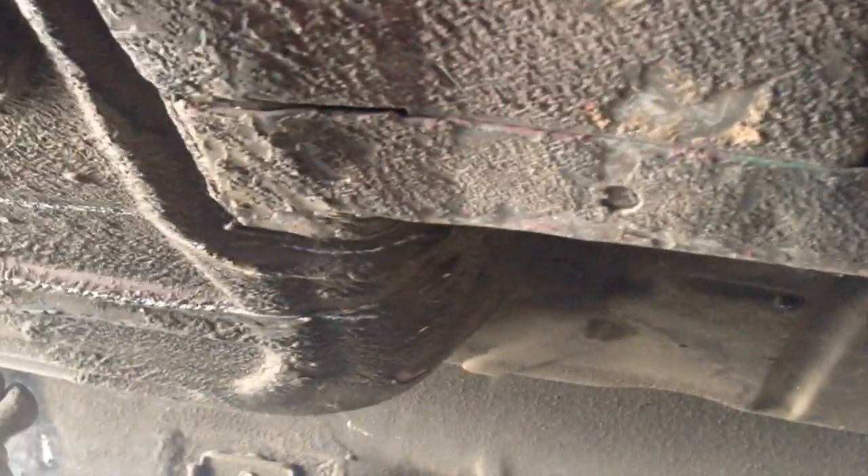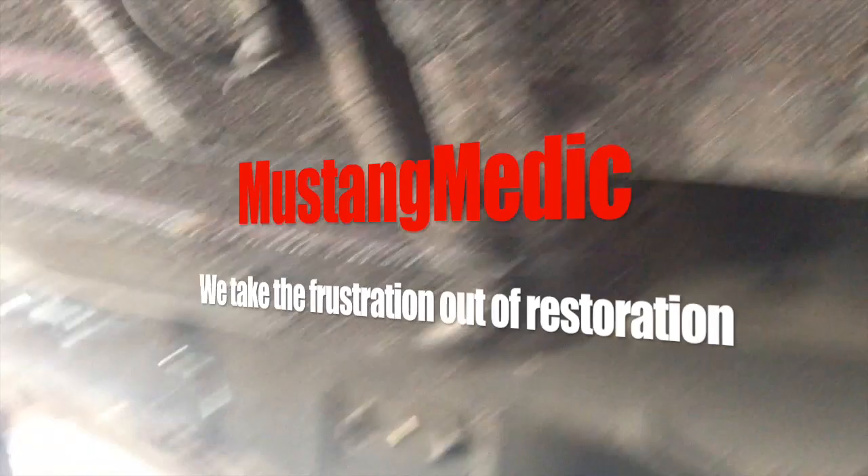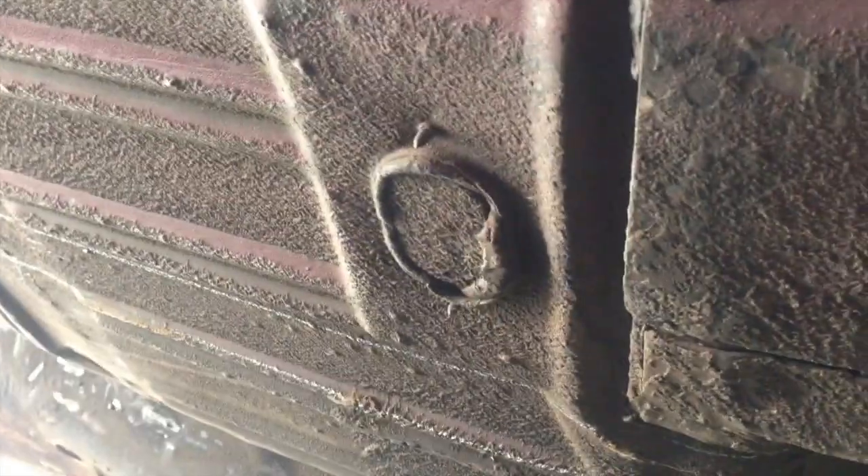He's gonna wire wheel away a lot of this crap before putting it in, just so he can weld anything we won't be able to get to later. He's gonna clean this up, wire wheel it, put weld-through primer right there underneath it, and then weld this to the car so we know there's no rusting going on and it's all gonna get interconnected.